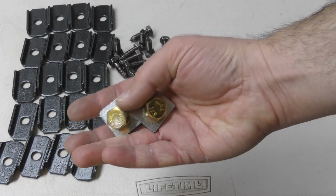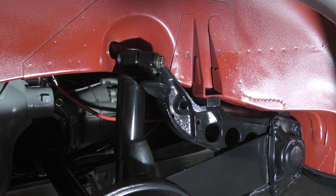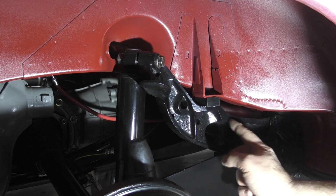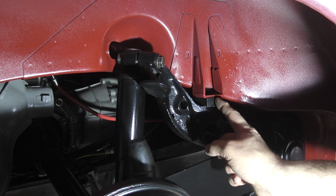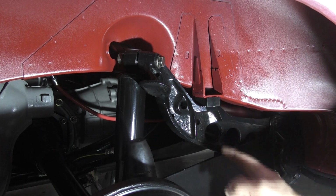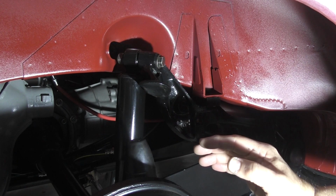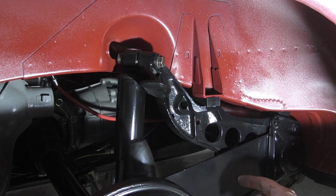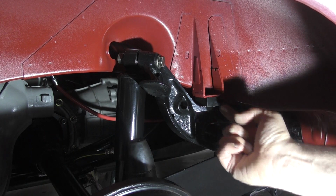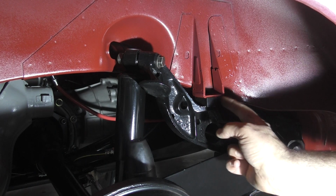Okay, next these two M10 bolts, 30 millimeters long, with the plates and washers, and these go behind the back tire. Out here in the back above the shock tower, there's a mounting that's welded onto the body, and that bolts right here through this grommet. This grommet on a Karmann Ghia as opposed to a Beetle is kind of critical because the thickness of this grommet will determine the door gap. It'll wedge the body up and angle it upwards a little bit, and you can open and shut the door gap at the top of the door. So we'll see what happens when they bolt the doors on. I might have to either put a wedge in there to push the body up a little bit, or take this out and slip in something a little narrower.